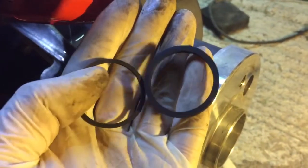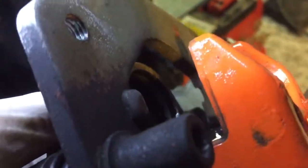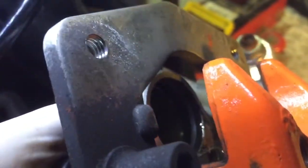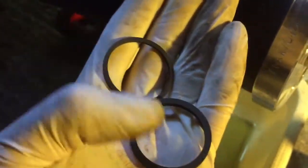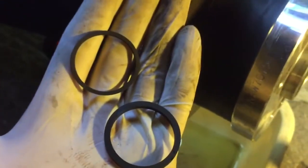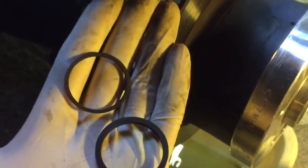Now that was the easy part. For those of you who also bought the O-rings, look inside. You'll notice that the thinner O-ring goes on the exterior and the thicker O-ring goes right behind it — so you've got two sizes. Before putting those in, I suggest you smear them with some brake fluid to make them nice and slippery, then put them into position. Same goes with the piston — smear it and then push it in.